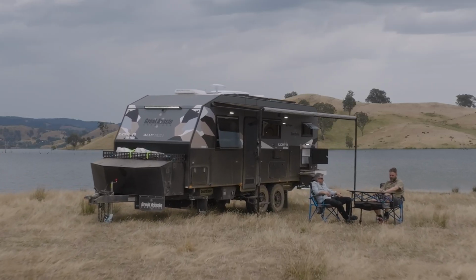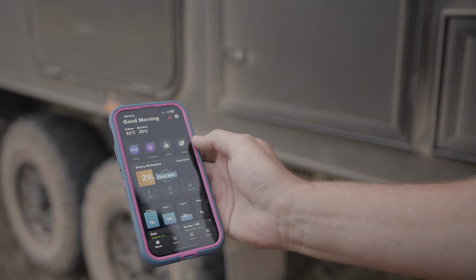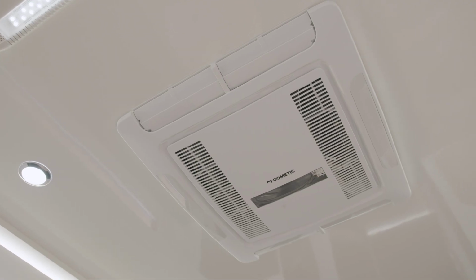Yesterday, in a partially cloudy day, we saw as much as 39.2 amp coming from the solar on the roof. That is the peak of the MPPT regulator. Now, altogether it means you can run your Dometic AC off your battery, but you will have to be careful on cloudy days or if you're going to abuse the privilege of your battery capacity. This combo should be comfortable for using the AC a couple of hours every day on a good day.